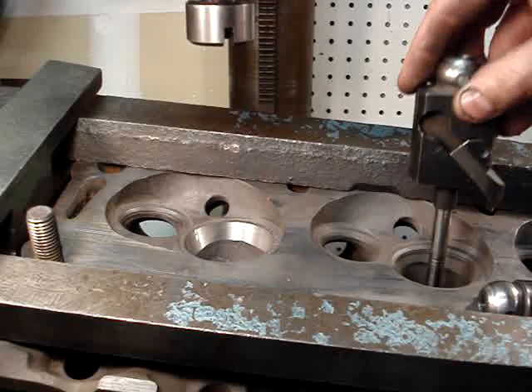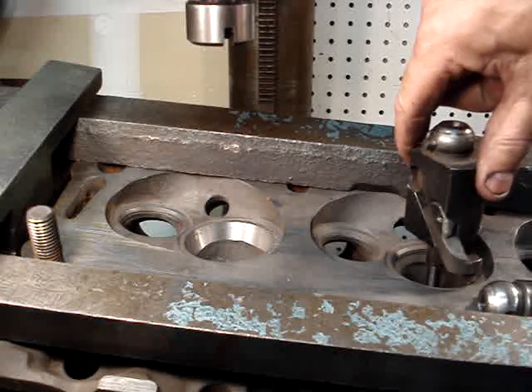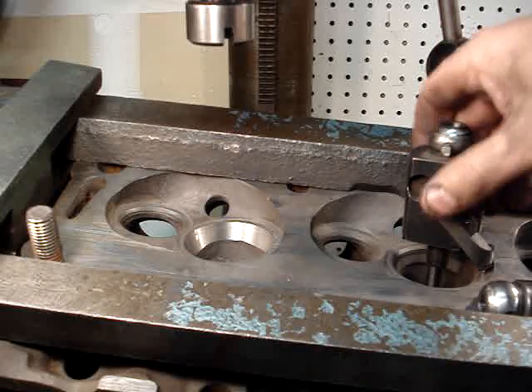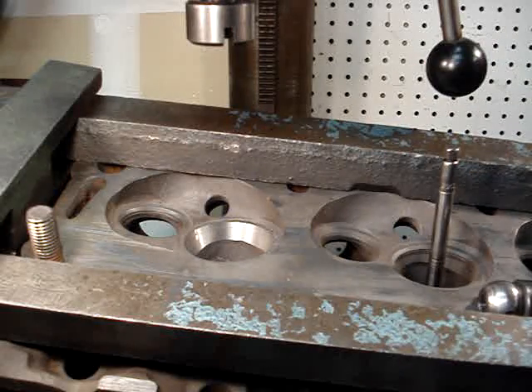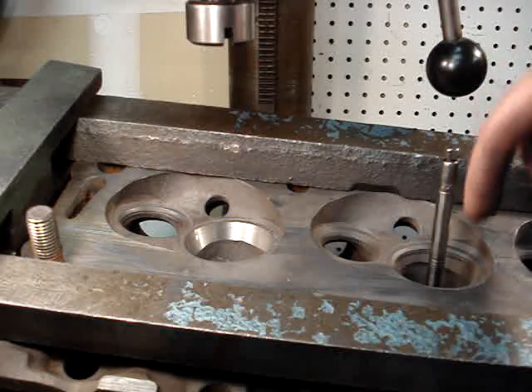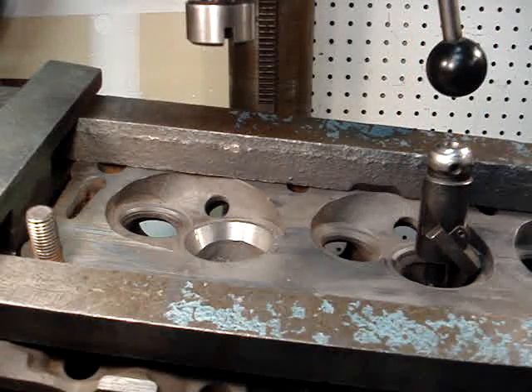Well, if you take a look at this, you can see that this cutter is sticking out way too far — I'm not even touching the throat with it. So before we can begin that final three-angle cut, we have to go in with what we call a bull hog and start cutting this throat out, get some of that material out of there.